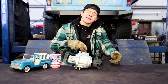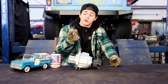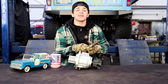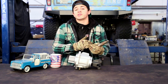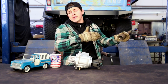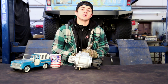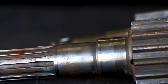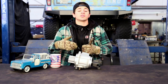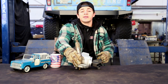But let's back up — why is your stock output shaft breaking in the first place? Well, for starters, it's likely that your stock output shaft has been taking a beating for 40, 50-something years. Your stock output shaft has been heating and cooling repeatedly — you get the picture. It's an old piece of equipment. Another reason it's such a common breaking point is because the diameter of the actual shaft is so small. Ford didn't have the type of wheeling that we do nowadays in mind, so back then it may have been cream of the crop, but today it just isn't going to cut it.